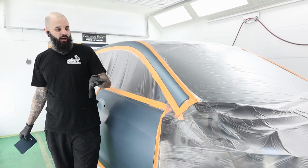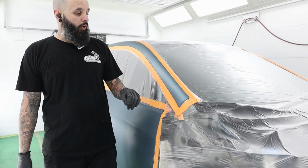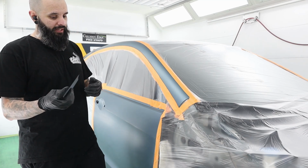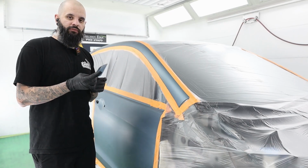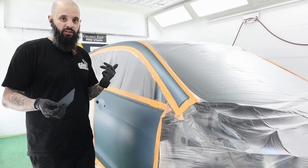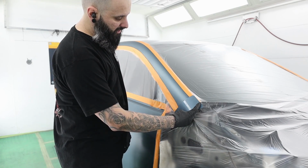To start this off, when I'm color matching, typically I'm going to be checking against the panels that I already plan to blend. If I'm trying to panel paint something, which isn't very often, I will check against where it's going to butt up. Now, I'm painting on both sides, so I was checking it side to side. Couldn't find anything that was 100% for both sides, because I have a feeling that that side is slightly different than this side. Happens sometimes when a car's been repaired before, even some factory cars. But I did end up with this variant that is slightly different.